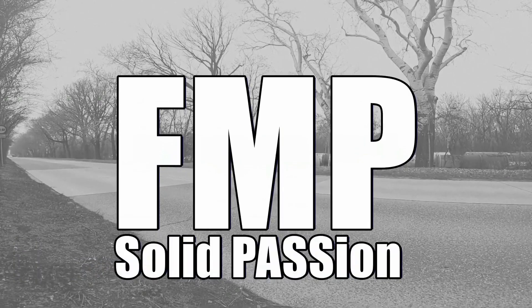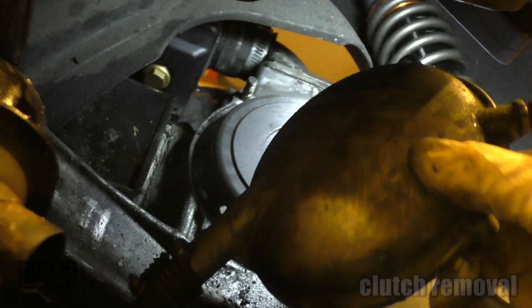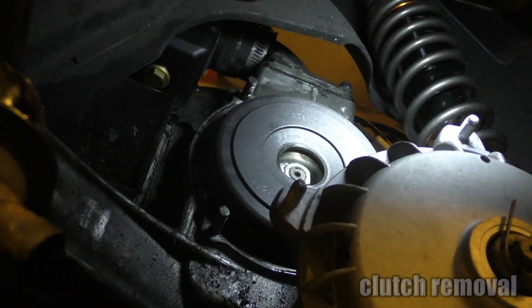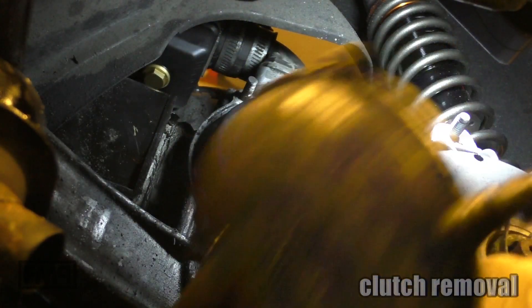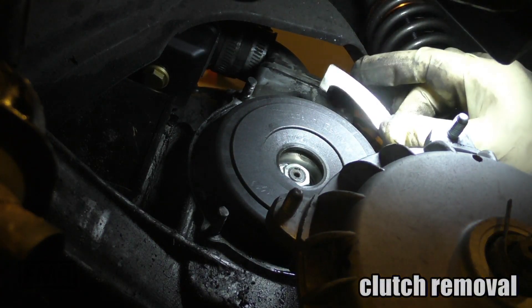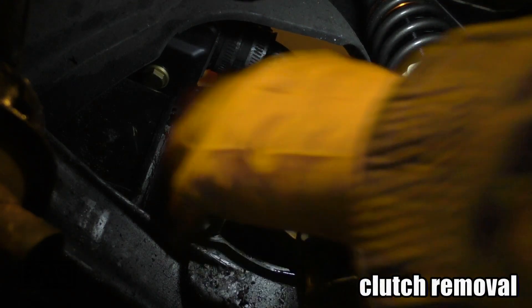What do we need? You open the clutch lid — I already did that, it's boring to show it to you again — and to remove the lid. The primary nut trick with the clutch lid, you can look that up. It prevents engine cases from cracking. You have to remove or loosen the primary nut first, then you can remove the lid.